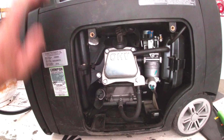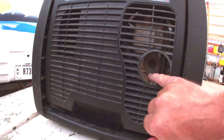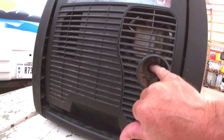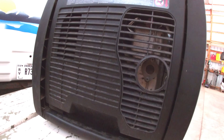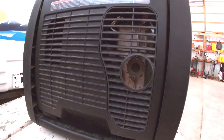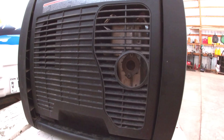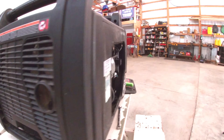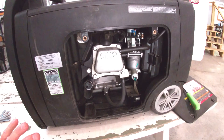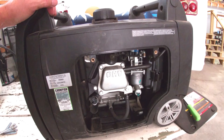Right above the valves is a spark plug. I pulled the spark plug out — since it's only run on propane, it looks brand new, no carbon or anything. And in there is the spark arrester. You take these two little screws out, and that little screen is like a cylinder in there. You pull it out — it was perfectly clean, no carbon, no debris. You can take a little wire brush and clean it up, but everything looked good. I put everything back together, started it up, and the thing ran like a top. I thought I'd learned something that day — that lady knew what she was talking about. Well, not quite.